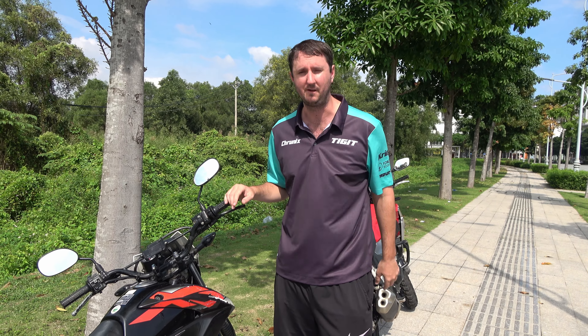We'll start with the CB because it's super easy to check. The first thing you need — it's really a two-man job — but the bike has to be completely upright and straight. If you tilt it just a little bit to the left or a little bit to the right it completely changes the oil level reading. So it does need to be as perfectly straight or flat as you can get it. Also a hill is not going to help. Down here on the brake hand side on the CB you can see the glass window.